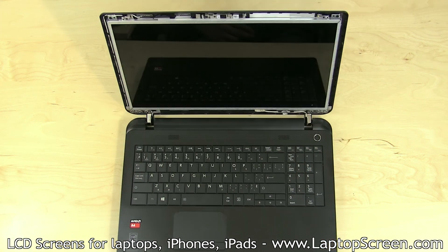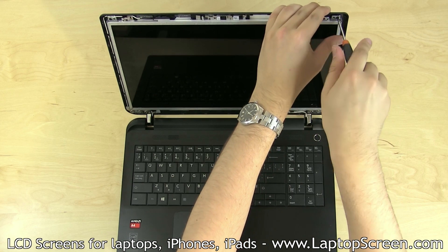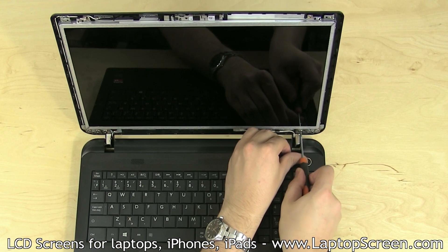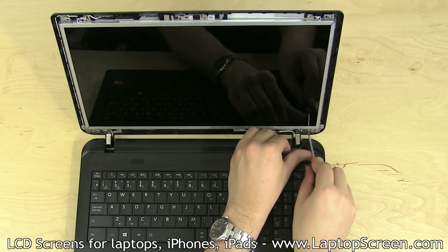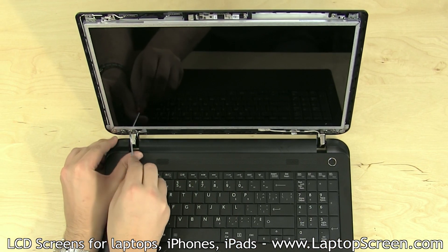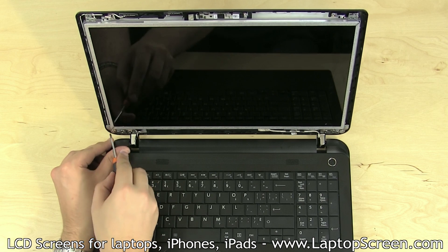The LCD is usually mounted with several tiny screws located on the side of the LCD brackets. Remove the top LCD mounting bracket screws. Loosen two, sometimes three, screws on each side where the LCD mounting bracket is attached to the hinge to expose the LCD mounting screws. One or two turns of each screw on the bottom of the LCD mounting bracket should provide sufficient access to the tiny LCD side screws.